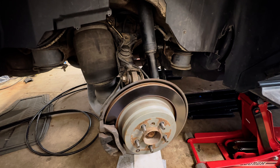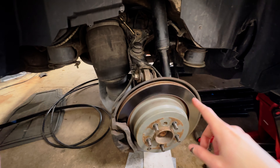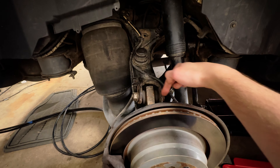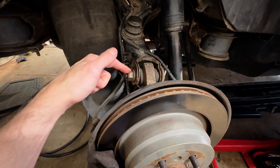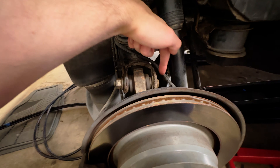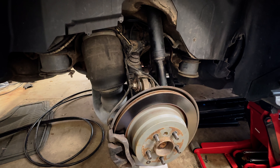We're back at the rear of the truck. I've jacked it up so I can get the wheel off and loosened the camber bolt, so we'll be able to adjust the camber. My truck reads 21 on this side and 18 on the other side. Let's get the wheel back on and the truck back on the ground, then we'll set up our alignment tools.